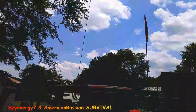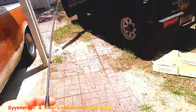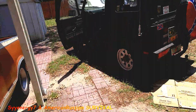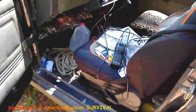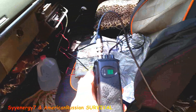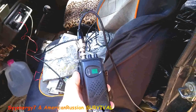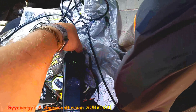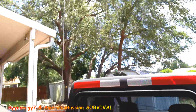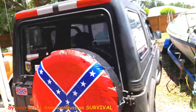I'm extremely happy with this 102-inch whip antenna installation. It's the first time I'm actually getting stuff on my CB radio. First time I turned it on, I tried this thing — it was just a three-foot, almost like a rubber ducky you can add on to the antenna. It didn't work. This one — let's see if it works this time. I was getting something on. This antenna has made a huge difference. I wasn't getting a damn thing before. 102-inch — that's the one you want, man. That's the one you want.